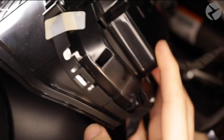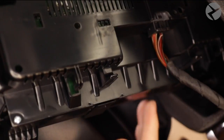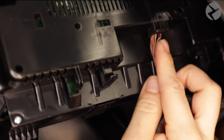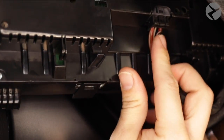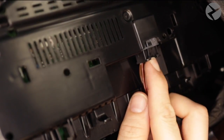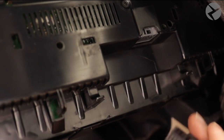On the right side of the cluster, you'll see the wiring harness is latched around a couple of hooks that keep it in place — note where those hooks are so the cable doesn't get pinched when you put it back in. Once that's loose, press the little tab that holds the connector in. For those of you with larger hands, this is where you'll want to grab the precision pick tool to press the tab in.